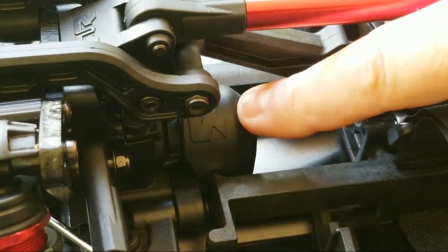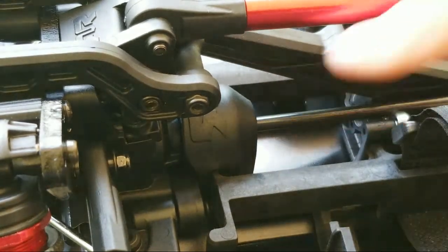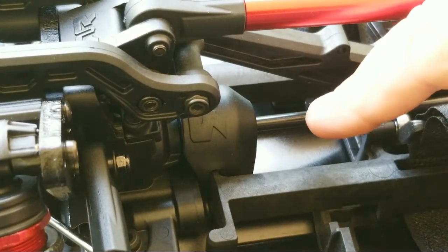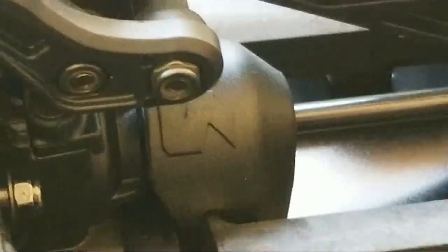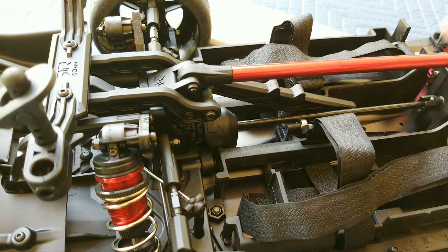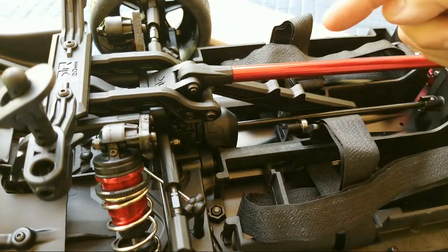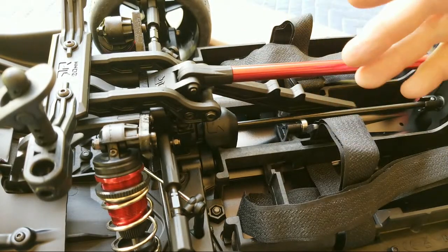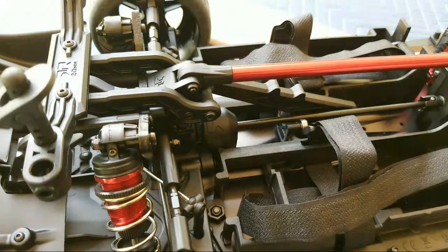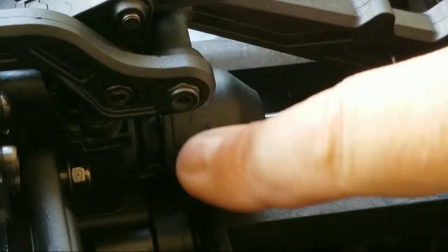So in certain instances with racing, you'll have what's called a drive shaft loop, and usually it's somewhere within the drive shaft. What it's supposed to do is, in the event of a yoke exploding or whatever, which is normally where you're going to have the issues, at least it'll hold the drive shaft in place and not kill the driver. It gives a certain amount of protection. So I'm thinking that's kind of what this is, almost like a drive shaft end point, like a loop or something.